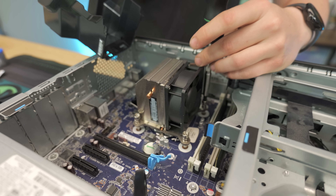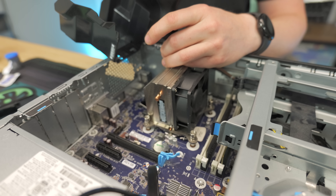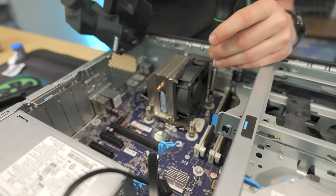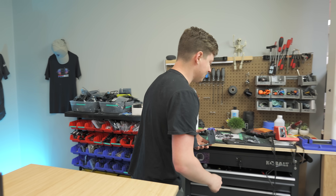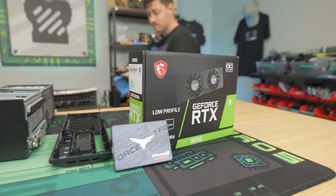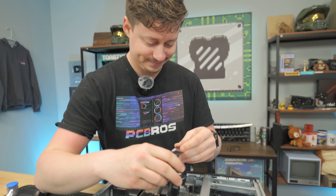The newer Dells — we used one really recently and all we could put in there is an A310. Buying those on eBay you're probably paying 70 to 90 bucks for those, and they're so limited in terms of upgradability. The CPU coolers are normally not great, and GPUs are going to overheat if they're not single-slot cards. So it's really cool to see a generation of workstation small form factors. I'm excited to see if everything works — we probably have a new build we can recommend. This is a good use case for the RTX 3050 6GB low profile — no external power required.